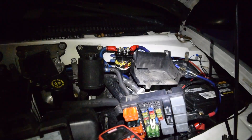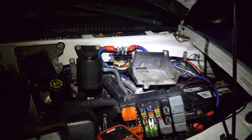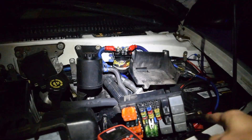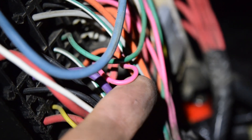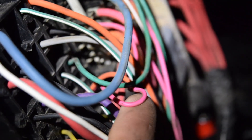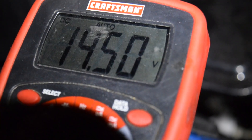To find a good location to tap into for the relay's power wire, I removed the negative battery terminal, pulled apart the fuse box, then reconnected the negative terminal so I could use my multimeter to find a source. I identified a wire that goes from the ignition to the AC enable relay — this is only hot when the engine is running. I'm going to use this one and tap into it with that little connector I showed you.